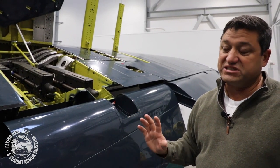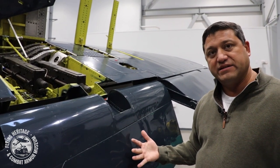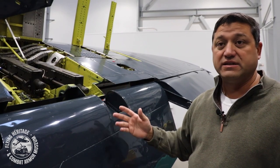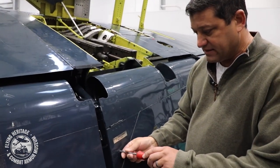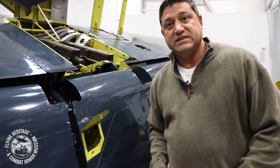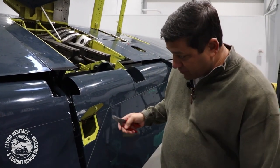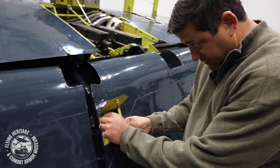Not unlike the unique feature of being able to extend the wing flaps with the footstep, you are also able to further extend just the outboard section to gain access to the guns for removal and loading purposes. To do that, you open this panel, then remove the safety wire — which prevents this from happening during flight — once the handle is moved.